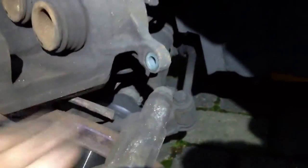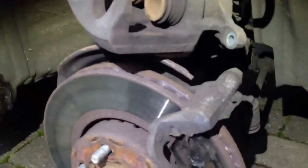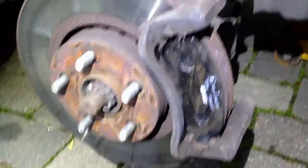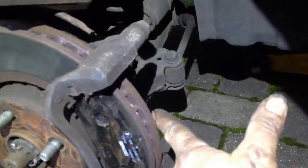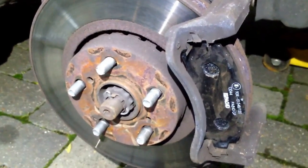Then I just take this and gently put it back on onto the brake pads, put the bolts back in and it's done. Now if I had a little bit of anti-seize grease — some copper stuff — I could put that on here to stop squeaking. But there we go — squish that one back in, and that one back in. There's two of them. Put the other brake pad on the inside and then we're done. Thanks for watching — I'll show you what happens in a minute.